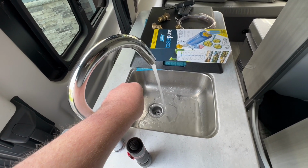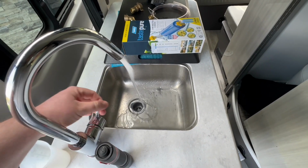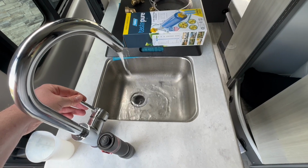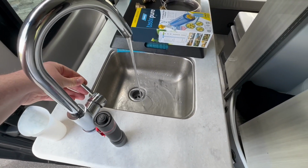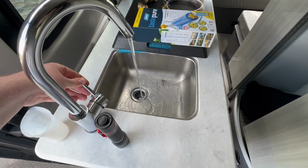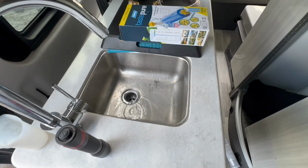Now I have it easy. I just have to turn on the faucets until I see a clear stream of water without air in it. Then I know that it has bleach solution in it. If you were dewinterizing, you would do this until the pink solution went away and turned clear. So this is nice, you can do 2 steps at once if you're sanitizing your tank right now.